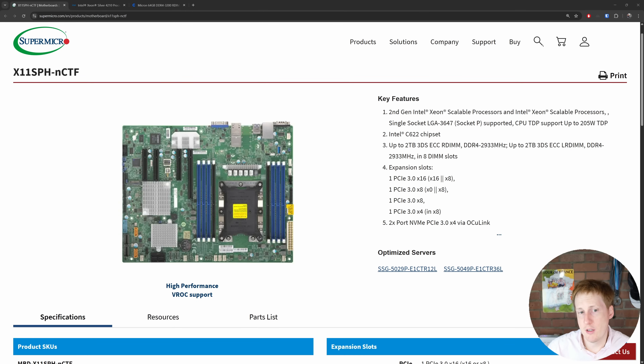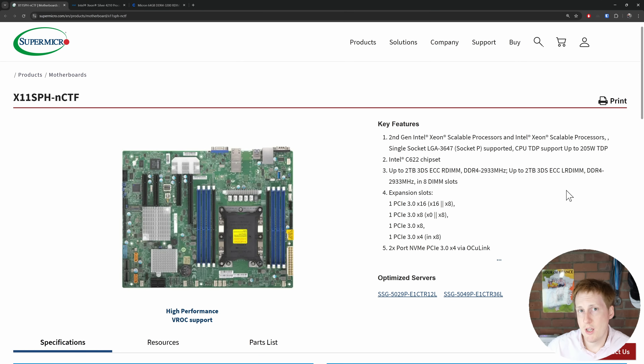The first thing that strikes you when you see this device is that it's using enterprise-grade components, most chiefly summed up with the motherboard — this Supermicro — and also the Intel CPU that it's using. This puts you into the workstation/enterprise space, so there's a myriad of features that also increase the price. On screen you'll notice off the bat the increase in PCIe lanes and also the speed at which those run. With the CPU they sent me, that supports up to 48 lanes — in the consumer space you're probably used to settling with just 24. That can be problematic, especially if you're trying to pass through things like GPUs, which will take up 16 lanes.